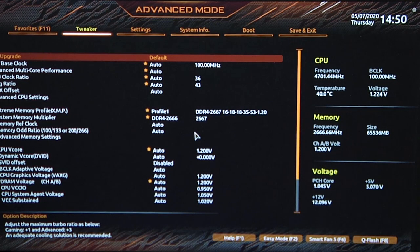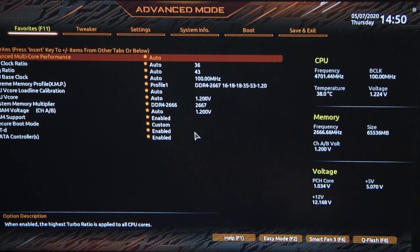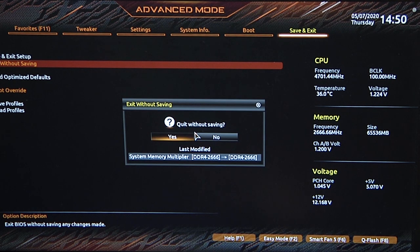After a successful boot, make sure the auto detect feature worked correctly. In my case, certain things were not set up correctly. My board enabled turbo mode where I wanted it off so the CPU stays at its stock speed, and the RAM was not displaying its maximum speed till I enabled the XMP profiles.